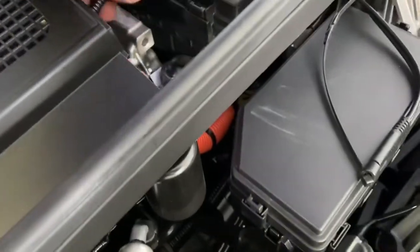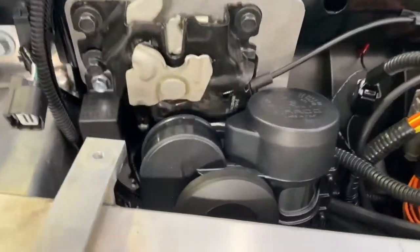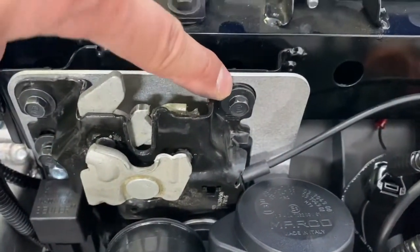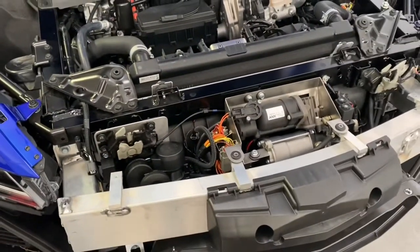It goes underneath and up to the battery. So this goes up to the battery. We remove the battery cover. And then if we're looking at the horn, now everything's installed. Factory bolts. We're gonna align this to the top here with that measurement we made earlier. So it's gotta be a 7 millimeter distance. That's what we measured earlier for the hood latch. Once that's installed, everything's back in the car, so then we can put the bumper back on.